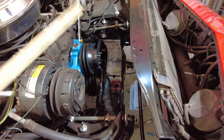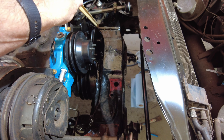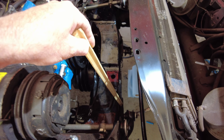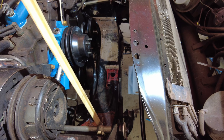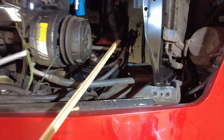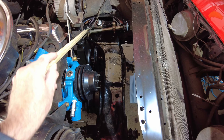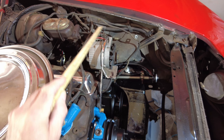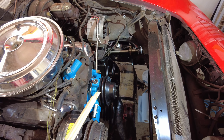Here's the engine bay. The new front line is basically going to run along here, then down — there's a lip here — and it'll come across this lip, then across the right front part of the frame and then over this side and around. It's all custom size so it should work. I still have the old one there as a final reference, especially useful to know where the clips go, so I'm keeping that there to know where to put the clips on the new one.